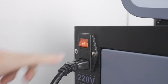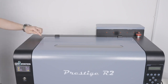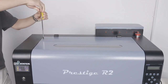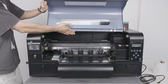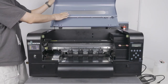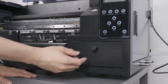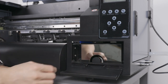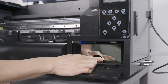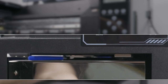At this time, turn the printer back off using the power switch in the back. Once the printer is off, take a Phillips screwdriver and remove these two bolts on the top of the lid — this will allow you to fully open the top cover. Now open the front cover and rotate this knob counterclockwise. Keep a close eye at this opening; as you rotate the knob, you will see the capping station detach from the printer. Make sure that the wiper blade is lower than the carriage before shifting the carriage to the left.